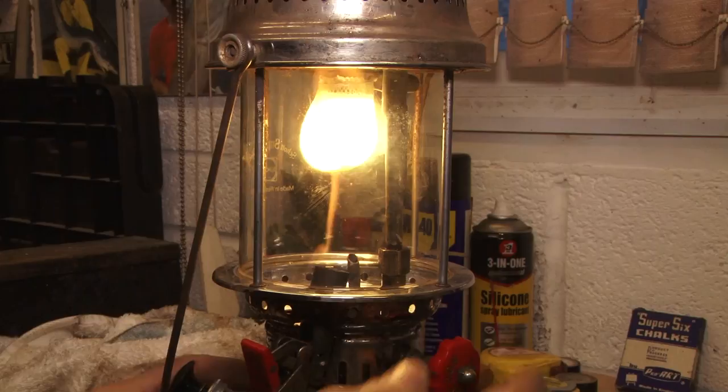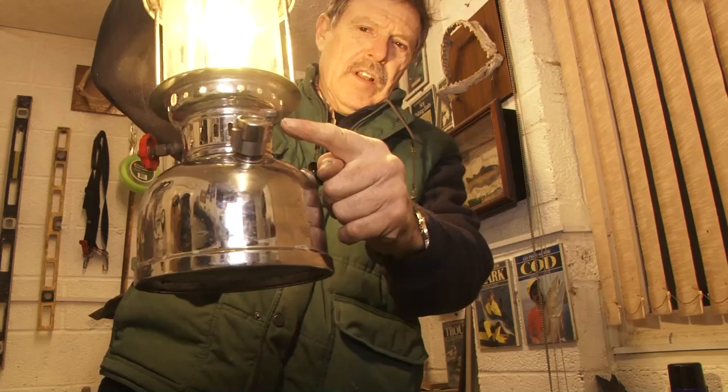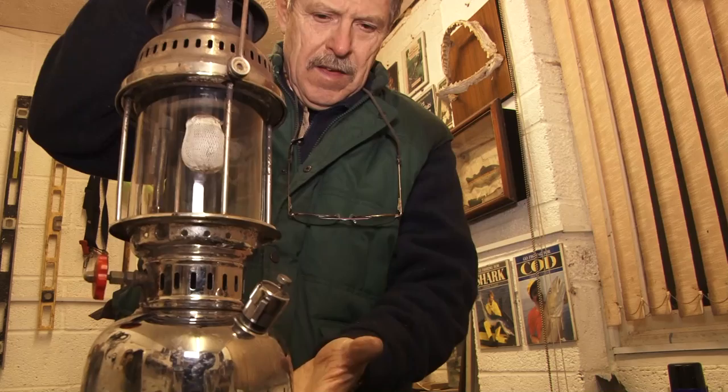There we go, we got lucky! Nearly too much — you see it flame out there. I'm just going to leave it like that because I want it to vaporize inside that mantle. Now it's getting hot, the last of the meths is going to burn away. I can just tweak it back a little bit on the pressure — I've still got over one on the bar pressure. And hopefully you can see that on the camera — it is indeed going and it's getting warmer around the top as well. That's what you call a pressure lamp — it's working after all those years!